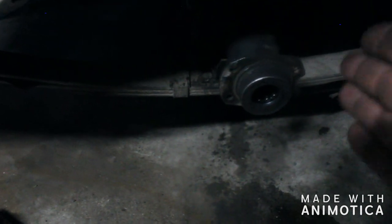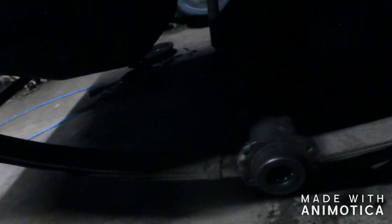Now this, like I said, is an 8.8 limited slip, 3.73 gearing. And the biggest key for this thing, why I went and got this rear end and not an Explorer, is that this was free. The cutting and narrowing was free. The only thing that has cost me so far is the saddles, $13 or $14 from Summit Racing, and that's all I've got in this rear end right now. So I cannot be more grateful than that. Now the only thing I have to do is go buy axles. But the deal is, the rear end is in there.